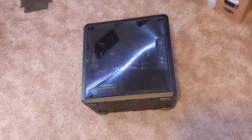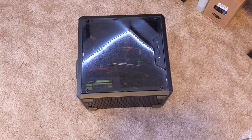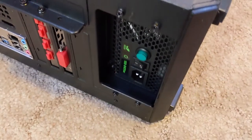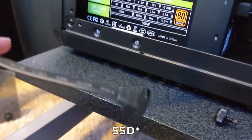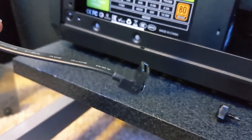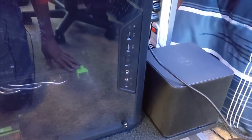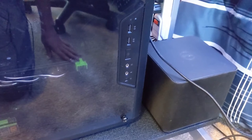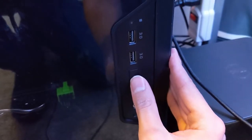I think I am finally done. Now I got the panels back on, dust filters are back on. All I have to do is take it to my desk, plug in the power cable, plug in all my peripherals, and see if it actually turns on. But first, make sure your power supply is turned on. While I was carrying it to my desk, I realized I forgot to plug in the SATA data cable that goes from the motherboard to my hard drive so that it can communicate with everything else. Okay, I have everything plugged in — my power, my display, my peripherals, and my Wi-Fi. Monitors on, everything's on. I'm kind of scared because I did not test this before I started assembling everything, which I should have done. It's better practice to do that to see if there's any dead parts, but I was too eager to get this build done. Three, two, one.